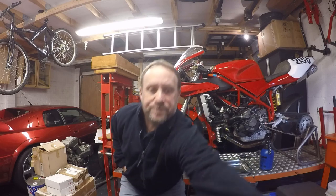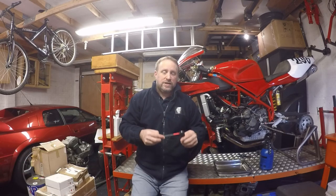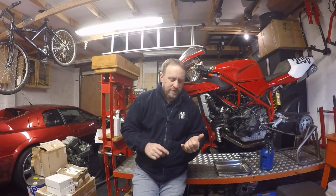I've got a new set of HT leads — Magna Core 8mm leads. They're slightly better for longevity versus the standard Ducati ones, and were roughly the same price as the OEM ones. In line with the new ACU regs, I've also got to fit a brake lever guard on the right-hand side. Then basic servicing: although I've only done one meeting on the oil, I'll do a fresh oil and filter for the new season. I'll also check the belt tension — not changing the belts, but the bike has done about 100 miles on track since the build.